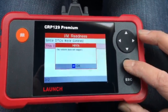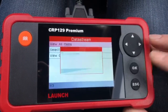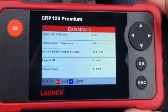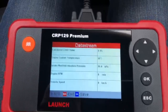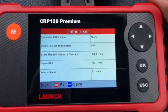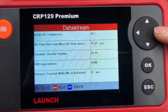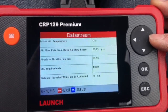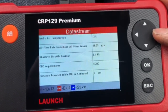Since the DTC codes were cleared, it tells you what the drive cycle is and so on. Let's look at the data stream. Engine coolant temperature at the moment is 59 degrees — I've been out for a drive, so that's about right. Intake manifold pressure — let me start the car. There we go, that's a bit better. So this gives you a live data stream. Intake air temperature, air flow rate — that'll be from your mass flow sensor — and your throttle position.